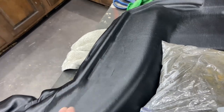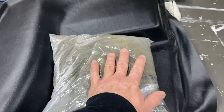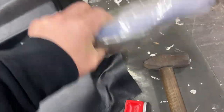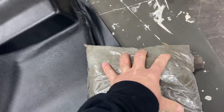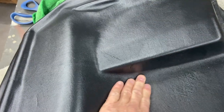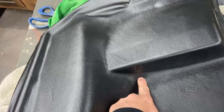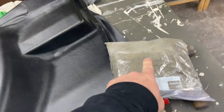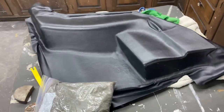I was putting them in socks for a while just to keep some of these marring imprints from happening, but they do release. You are going to find that some places just don't want to cinch — they just don't want to grip. It takes a while; you've got to work it in with a little bit of weight overnight. What I really wanted to show you is this is a bag of oil dry with water in it to make it nice and heavy, but it's also form fitting. You can smoosh this into the little concaves. I smooshed it down into here overnight and you can see that's laying in, but there's still a little bit — so I'm going to have to put some heat on there and do it again. If you are going to do this work, make yourself a few of these — it'll help you out for sure.